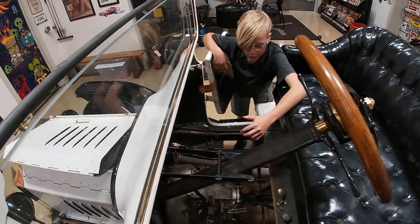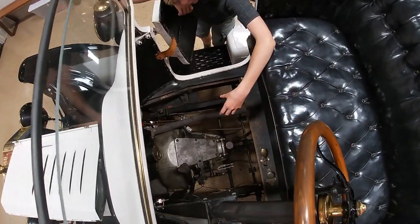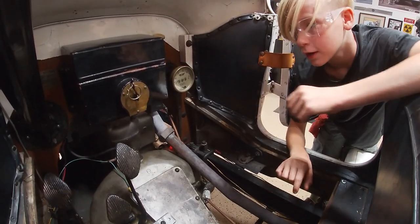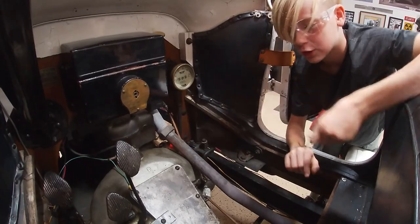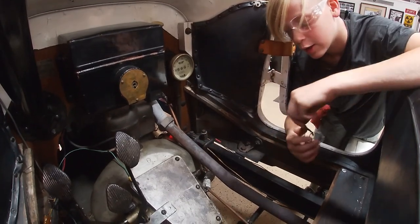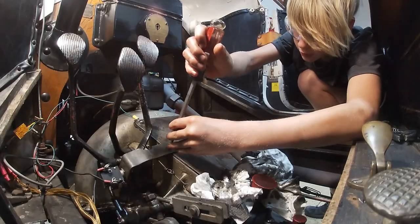Take the floorboard off — here's one piece. Now I've gotten to the inspection plate and I can start working on taking it off. One thing a lot of people forget is to take the key out before you take the inspection plate off, because if your key falls down into the transmission case it's very bad.